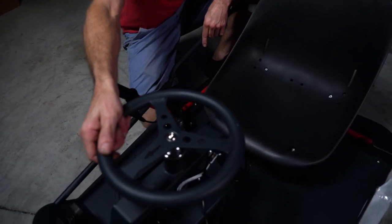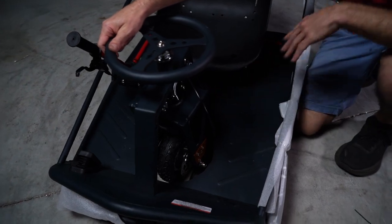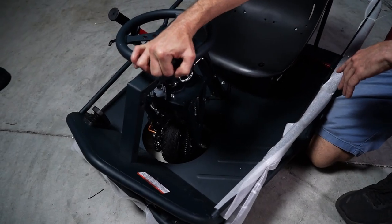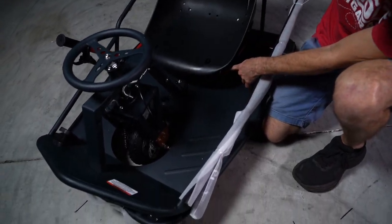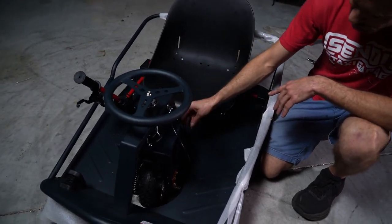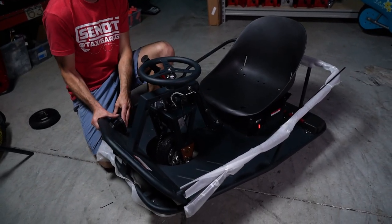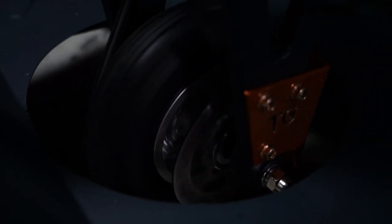Step 15: look over the cart, check all the nuts and bolts, and confirm everything is nice and tight before sending it. Make sure the steering wheel is tight, the fork headset is properly adjusted, and the cables aren't interfering. Steer 180 degrees clockwise and 180 degrees counterclockwise confirming cables don't stop the fork. Confirm the seat opens and closes safely and all cables and mounts are properly secure.